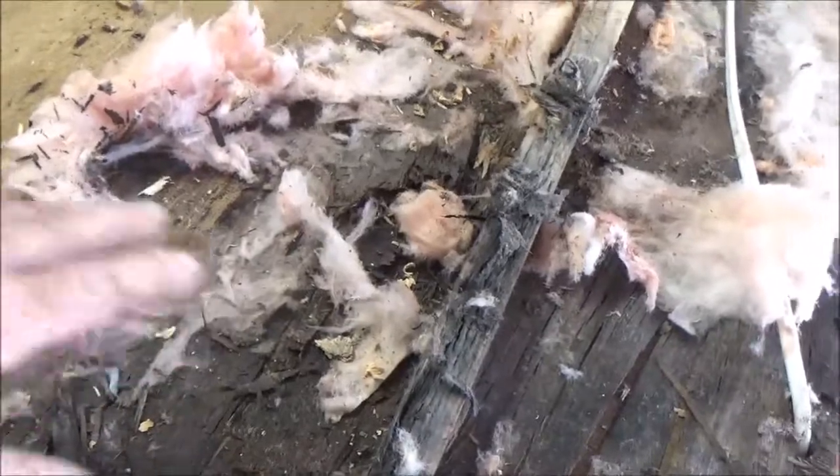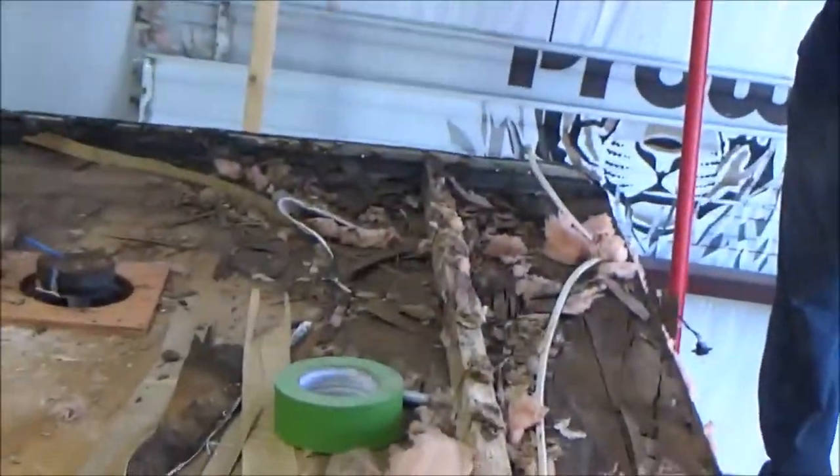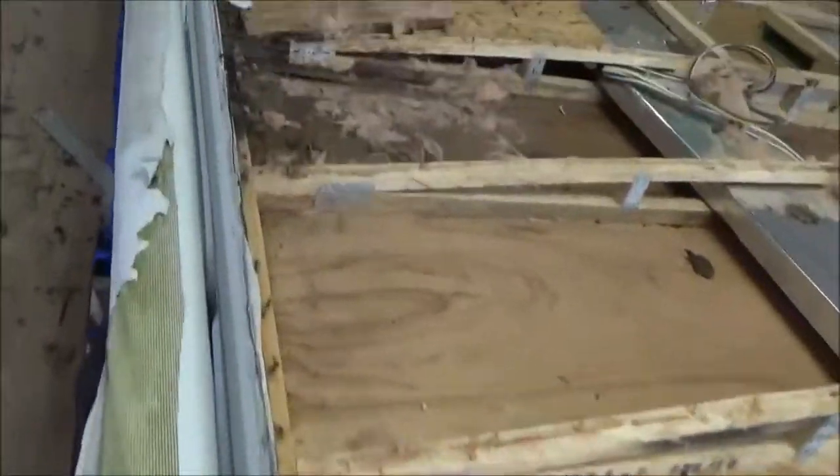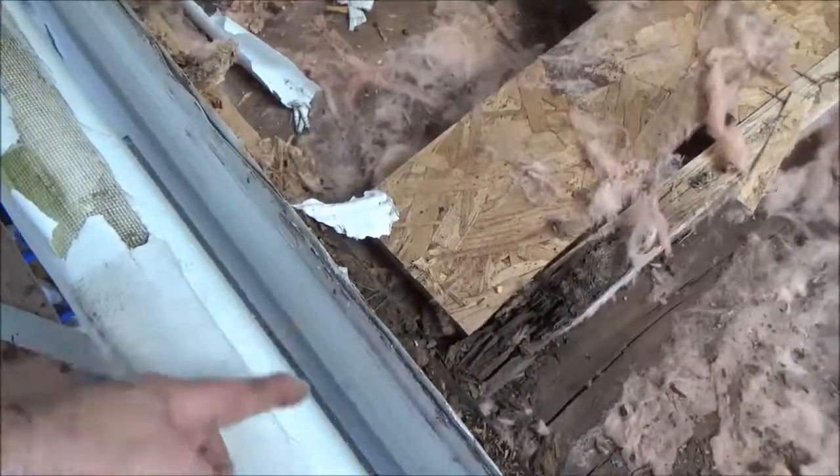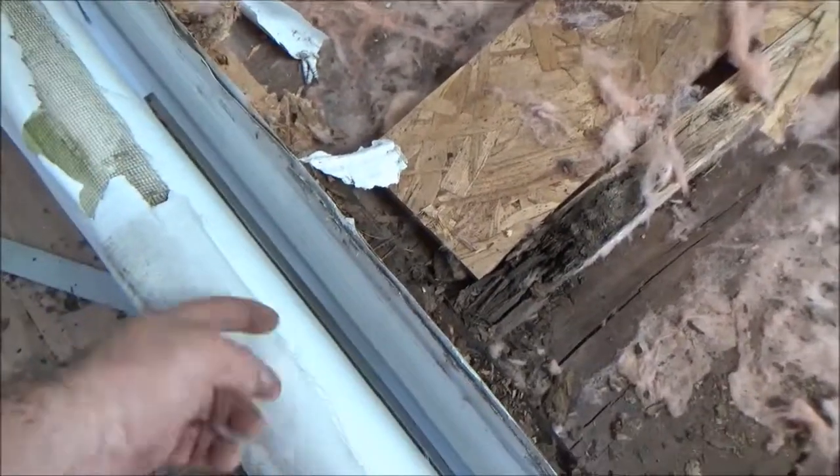There's the ceiling of the roof assembly - see how rotted it is right here. Right up underneath there is the ceiling - it's just eighth inch, that's it, just that little eighth inch right there. On the other side there's the vinyl. We just want to make sure it doesn't sag - there's really no strength on it, it's not a structural item. Then we've got some little rotting issues around here - like this truss is rotted here. This is a band - an edge band - connects all the trusses together. It also works so you can screw the termination bar when the roofing comes over. Usually the awning collects too.